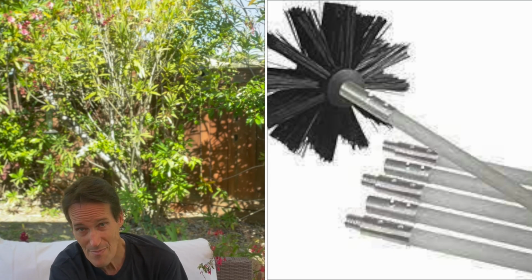So that's about it for reasons that dryers won't heat. And I run into it a whole lot as an appliance repair technician. It's one of my main calls that I do, and most of it is very preventable, if not all of it, but most of it is very preventable if the homeowner is willing to get that tool and clean out that dryer vent tube.